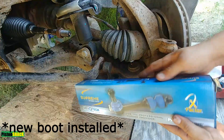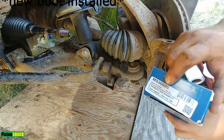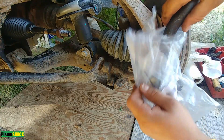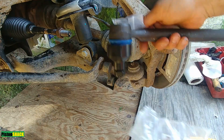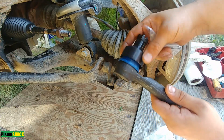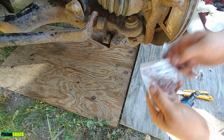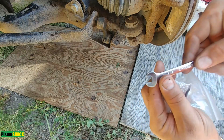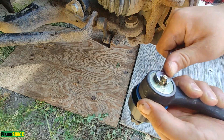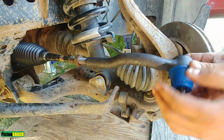Check it again when you're ready to put the new tie rod back. I'm using an aftermarket part — pay attention to the part number, as different suffixes are for different sides. Here's the new one — nice, clean, and it has a grease nipple. Use a 5/16 wrench or socket to install the grease nipple so you can keep it greased.